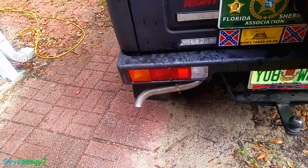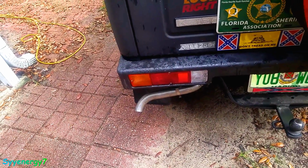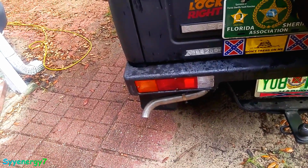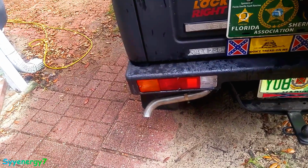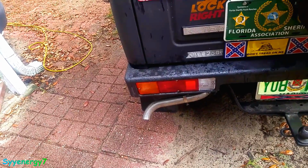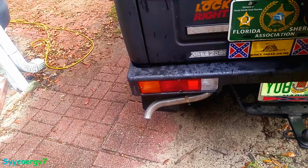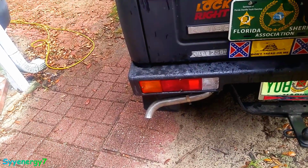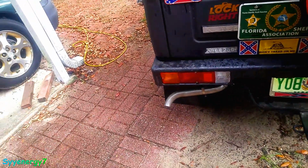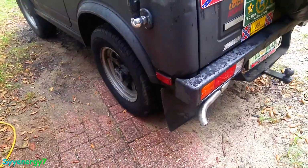To put this muffler and tailpipe on, you really need to take out the rear shock to give you enough room to slide it in there, but it's not that big of a deal. I use stainless steel bolts on the two bolts for the flange, where it joins the muffler to the head pipe or mid pipe, or whatever you want to call the regular exhaust pipe. I like to use stainless steel bolts whenever possible, because when you go to change them out again, they get too rusty. A couple bucks for stainless steel bolts saves you a lot of money. So that should solve that problem.